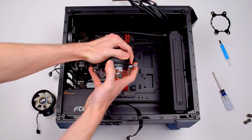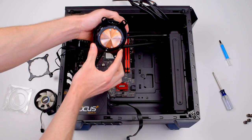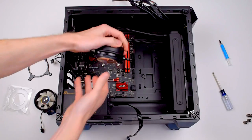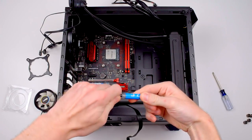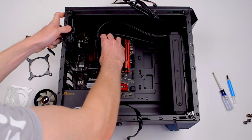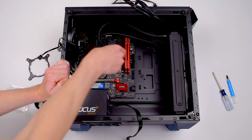Now to install the pump, the first step is to put on the right mounting bracket. It comes with the LGA bracket already installed, and to swap it out for the AM4 bracket you simply twist it counterclockwise and take it off. The AM4 bracket locks by twisting clockwise and can be mounted in any orientation depending on where you want the tubing to go and where to aim the airflow fan. The A40 usually comes with thermal paste pre-applied, but I'll be using Deepcool Z5 for testing. Because I wanted the airflow fan pointing towards the VRMs, I had to hold the pump firmly in place with one hand while threading on the mounting screws with the other. Once I got three of them mounted, lining up the fourth and tightening them all down was a cinch.